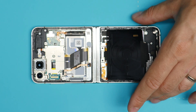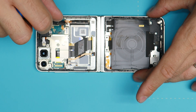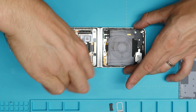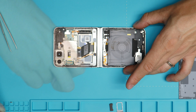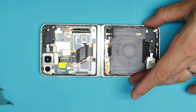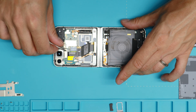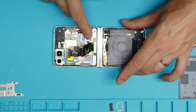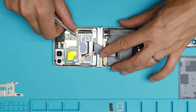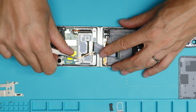The bigger one is located in the bottom part and the small one is located on the top part. How you can exchange them is pretty easy. We start with the top one and we are disassembling the screws. So we disconnect the flex cable — the sub-to-main flex cable going from the bottom to the top. It's connecting here to the bottom part of this phone. And as you can see, this is the battery connector, and some other flex cables.